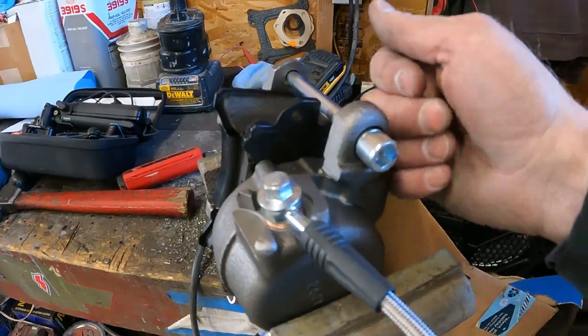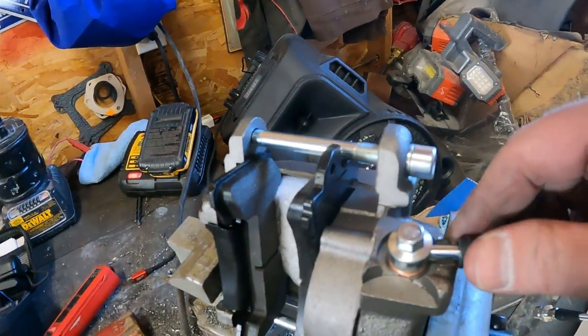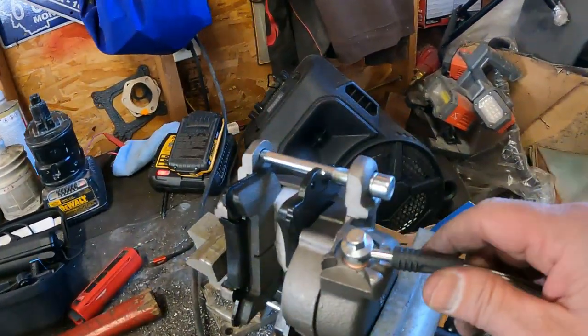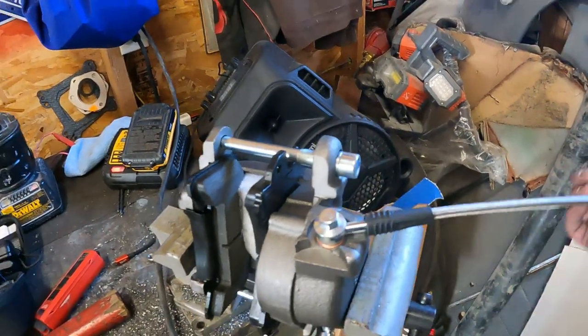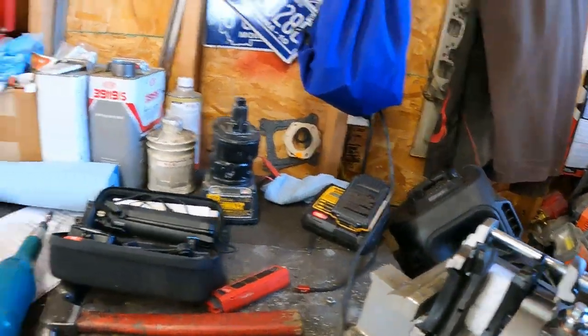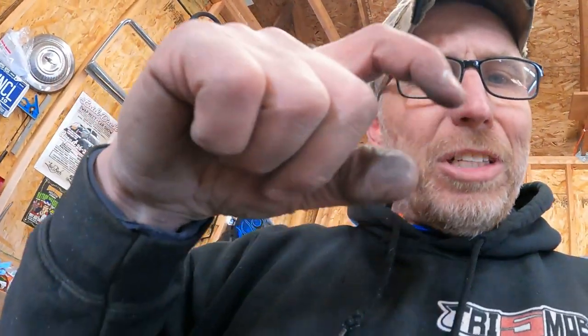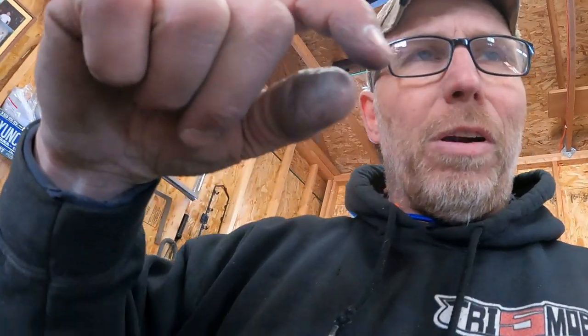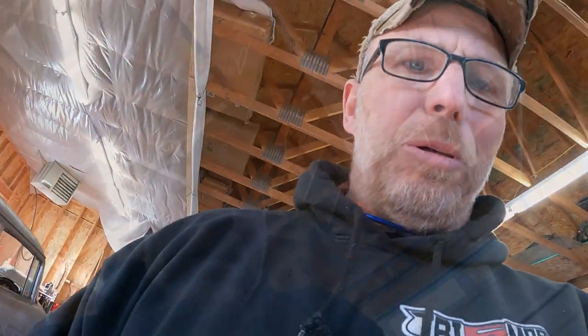So I'll take the tires and wheels off, throw this caliper on, pull that caliper off so I can bring it over here and then notch it. I don't quite have enough room to get the die grinder up in there with it on the car. So it's not that hard to get off. So we'll get both of those done. And then that way we can figure out exactly where the little tabs got to be welded on the axle. And then we have to make a hard line that connects this end of the passenger side. We'll make a hard line that'll go to that flexible hose, the braided hose with a T on it. And then we got to have just a little teeny short section from the T to the driver's side. So let me take some stuff apart and then we'll come back and see if we can get anything accomplished.